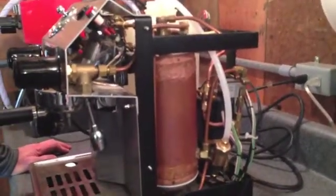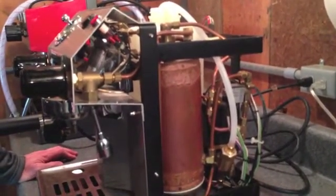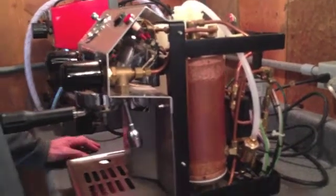We're going to go ahead and take it up to pressure. We hopefully have it set at about 10 bar for the OPV valve to kick in — that should give us about nine and a half bar through our coffee puck for the espresso. Let's turn it on.